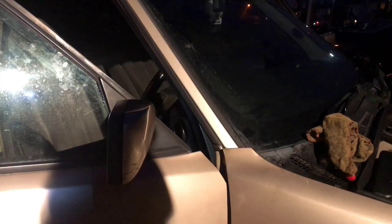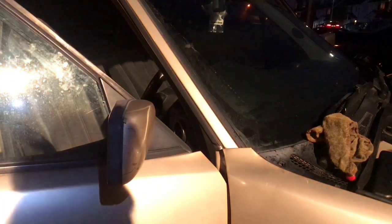When we took the fuel pump fuse out, we've done it again for a minute, then we've just started up and it's as good as gold. So crank it over before we put the fuel pump fuse back in. Folks, that's how you change a chain tensioner on a BMW E34 540. It's a flipping job well done — she's now really quiet, no rattles or ticking or nothing. We had a bit of a scare at the end because we didn't crank it over with the fuse out of the fuel pump long enough.